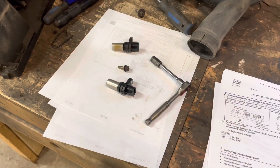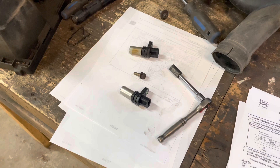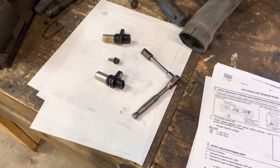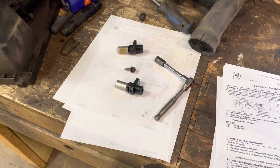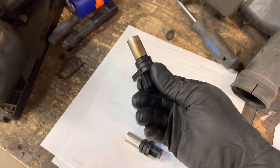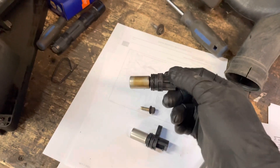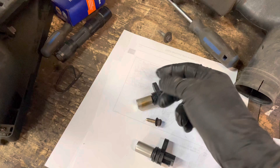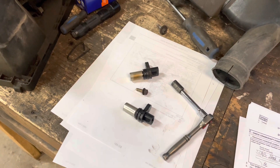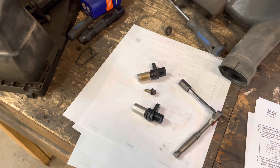Hopefully just with that information — and this is really the biggest thing you need to know to do this job. That should fix that code. It could be something else, like the wiring from that sensor being messed up, but it's usually not the case — it's usually this sensor. I think I changed this last time about seven years ago, so that's the general lifespan. This one's aftermarket, so maybe aftermarket ones don't last as long — the original was about ten years, aftermarket seven. Thanks for watching.